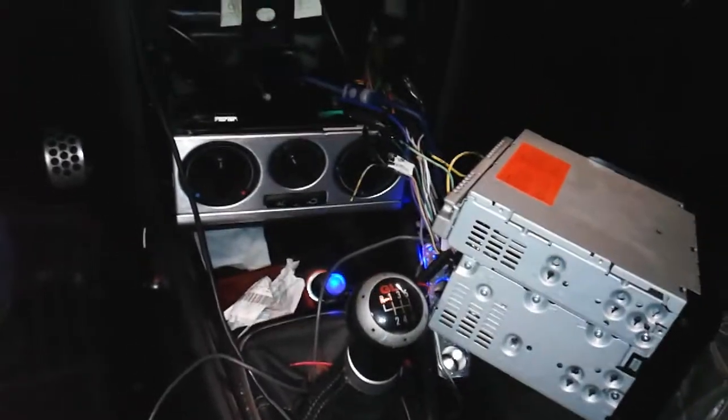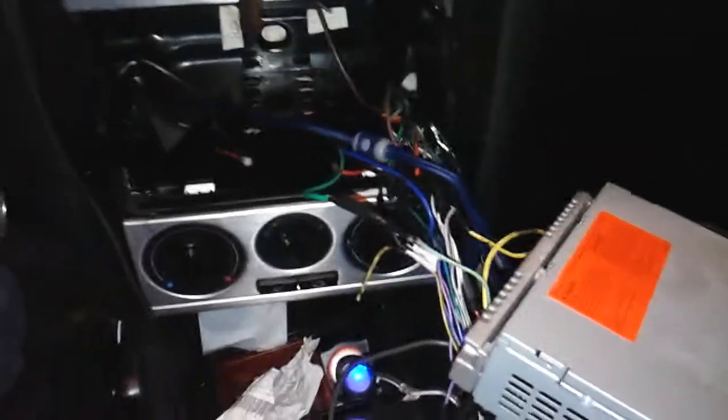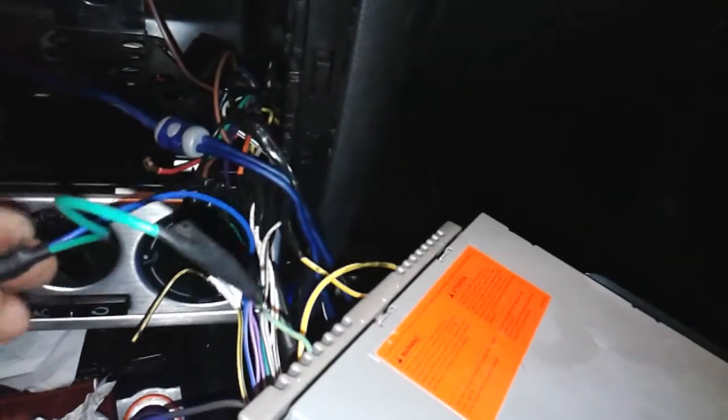I actually did my wiring right this time. A lot of times people just electrical tape them and it kind of gets on my nerves, because after about a year or so you might start getting shorts. But what I did was took it all in the house, soldered it up, and then taped it. So now it's all taped and soldered, so it won't come loose whatsoever.